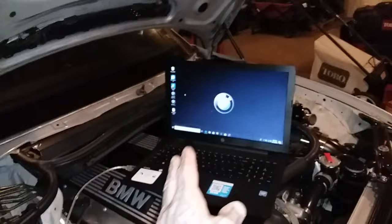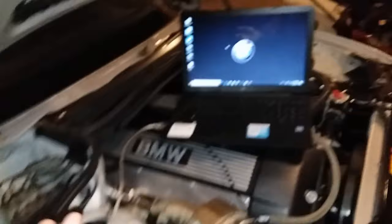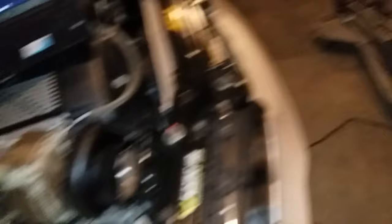As you can see, using these two pieces of software is so easy to flash the car. I'm sorry if I'm not a big help when it comes to actually tuning, because I don't know how to do that. I did not want to risk messing up anything with my very first turbo build. When it comes to piggyback tuning, that is a waste of time — you'll make decent power but you cannot get in there and fine-tune everything. There's no sense in it since the stock DME is so dang tunable and easy.